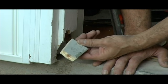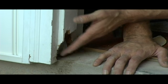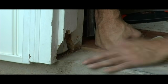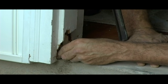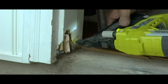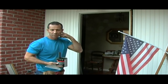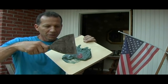This is a good-sized hole, so I took a couple of pieces of wood and stuck them in there to fill that void up a little bit. I'm going to fill it out to here with fiberglass — there's no sense going way back there. You can use anything to fill the void; you could even jam aluminum foil in there, because the fiberglass is going to grab everything. This is Bondo Glass — it's fiberglass mixed with Bondo, there are strands in it. I use this to fill large cavities, then I'll come back over it with regular Bondo for smooth edges. I love this stuff; the best wood filler is plastic filler, as far as I'm concerned. Here's the hardener and there's my Bondo Glass — I'm going to mix it up good.